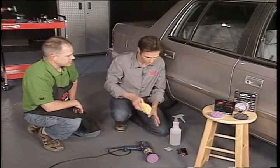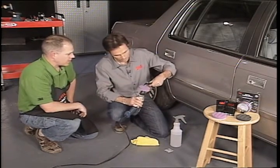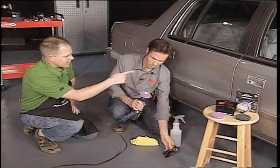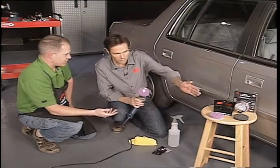So that's the first step. The next step is this pad — a purple pad with the rubbing compound. A purple pad is a coarser pad for rubbing compound to get that haze off and remove those sand scratches we left behind. And then you follow that as a very last step with a finer polish, which uses the softer black pad. So the sequence is: softer, finer abrasive as you go.